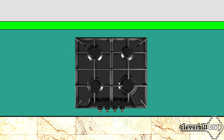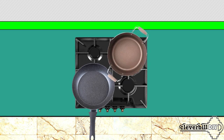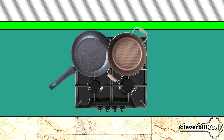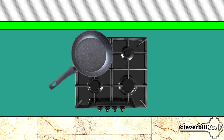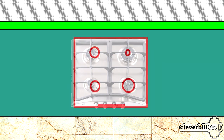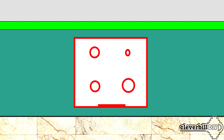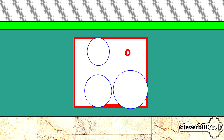In such models, due to the removal of the handles beyond the working surface of the panel, the distance between the front and rear burners slightly increases, and the handles are out of reach of high temperature. For a complete understanding of whether a gas hob is suitable for you, if the store has such an opportunity, you can place dishes on the exhibition sample. If there are no dishes at hand, mugs cut out of paper in the size of your dishes will do. If you choose a surface on the internet, you can draw the surface in real size on paper, asking managers of the online store for the distance between burners and their size, also noting the location of the handles. This seemingly unnecessary fuss will help you understand whether your dishes will fit and possibly save you from the wrong purchase.